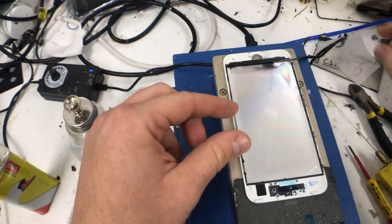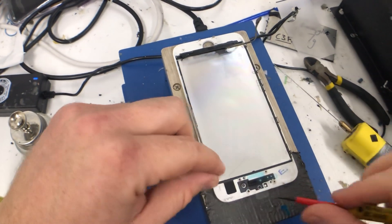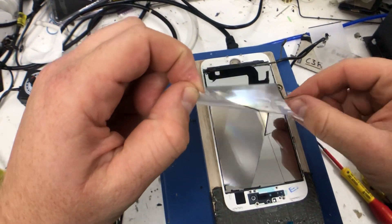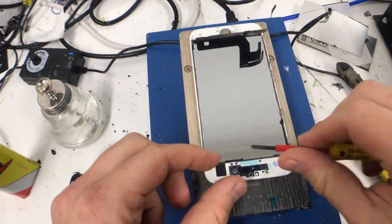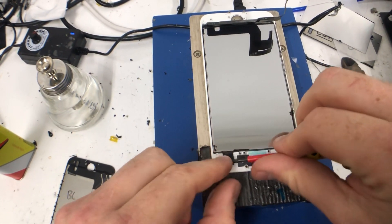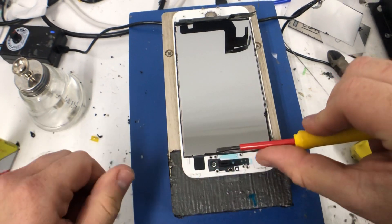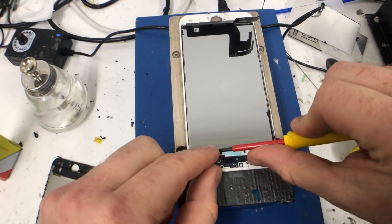It's got a couple of layers left so we'll get rid of this — this is the last layer here. Pick that in the corner and be careful not to get the mirror polarizer. If I didn't use liquid and just used heat, as this black adhesive comes off it can pull part of the mirror polarizer with it and that damages it. It is replaceable — you can relaminate it in the YMJ or reroll it with a special thin roller — but honestly it's a pain and I've got a stack of them I'm probably never going to redo.